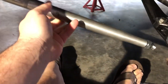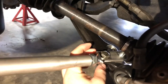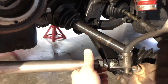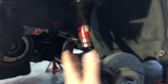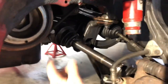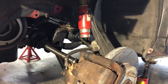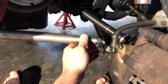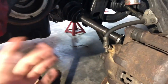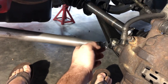It's the next morning — I wanted to finish it last night but couldn't. The flat steel is bolted on loosely to the lower control arm, and the cut heim joint is in place. The natural geometry of how the spindle sits will be a little back or forward depending on how everything is tightened. I don't have the lower control arm tightened or the suspension fork on yet, so this is free to move. When it's in its place it naturally sits a little bit further forward. I'll hold it forward, tack weld it in place, and then check the geometry before doing the full weld.